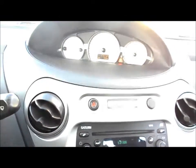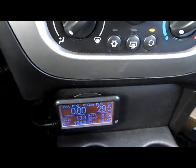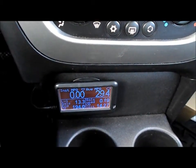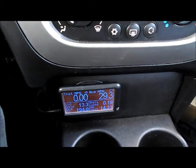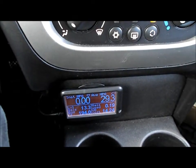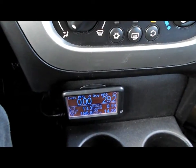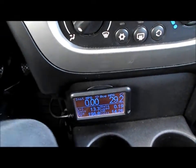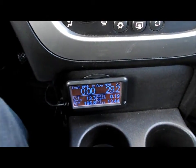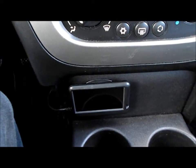You can straighten it out a little since it's on velcro. Not a bad spot, just kind of low relative to the gauges up above — but the cleanest spot available. Once I fill it for the first time with the gauge connected, it'll calibrate everything — when you add fuel, it asks exactly how much you added to properly calibrate the MPG. Right now it's reading 29.2 at idle, so I'll turn it off. UltraGauge installed — I'll do an update video once I refuel.